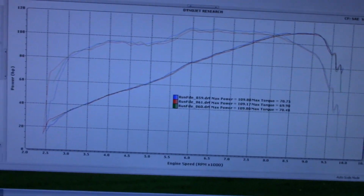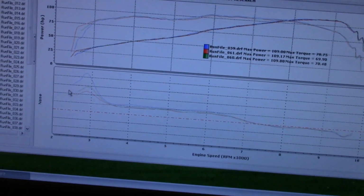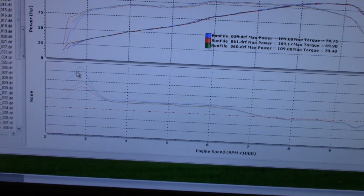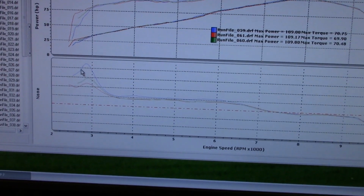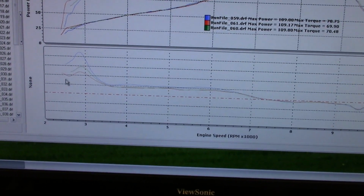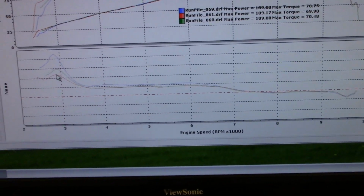Okay, there they are again. Let's put a double screen. Here's your airflow down here. So see, it's all repeating. The first time it's going to be even leaner, I found, on anything. When you first nail it, the cool air around the airbox and the heat from the motor starts building in, and that's more accurate. But see, that's still 15 to 1.